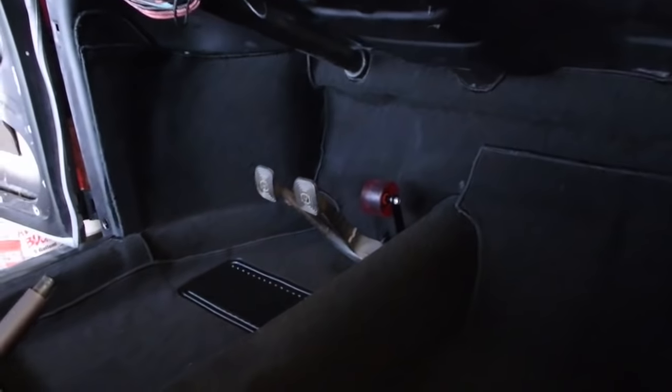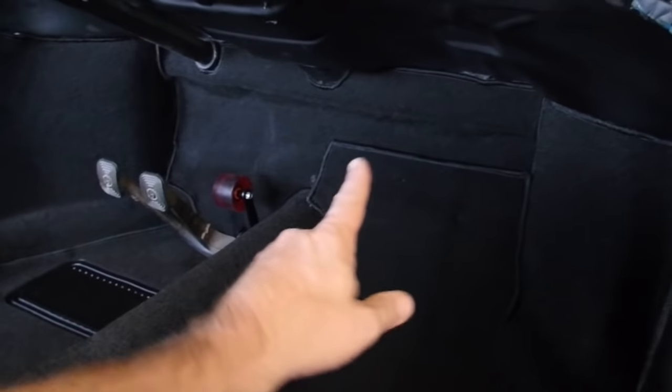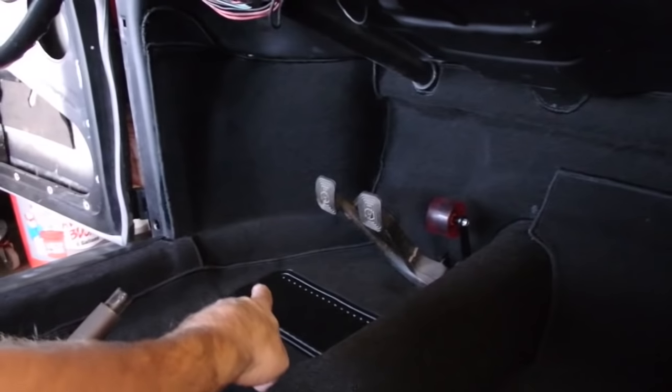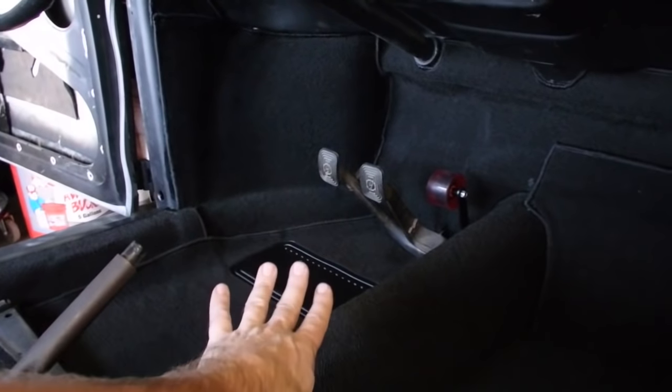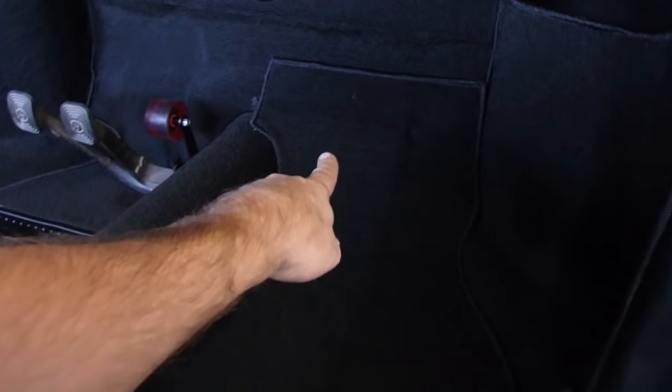Okay, what did I learn? A couple things. Number one, that placement is more important than that placement. So I should have started here because I got that where I liked it, but it's not a perfect fit. I mean, this is not the most expensive carpet. So after I went up, over, got all the way to this edge, this thing was off by a good half inch or more that way. So this area right here, where that section comes down and touches the floor right there, was in the wrong spot. So I needed to start there for my alignment.